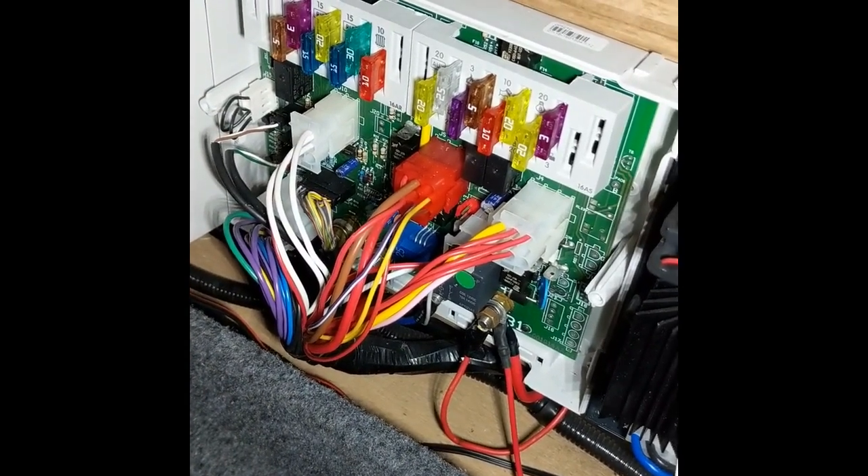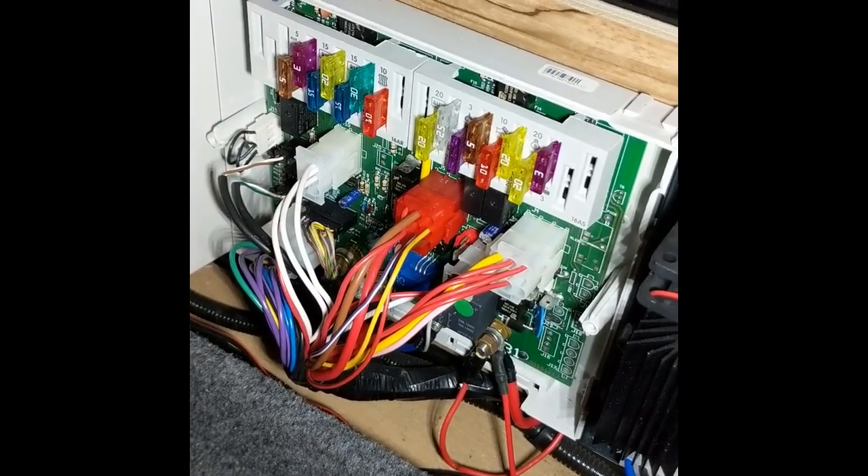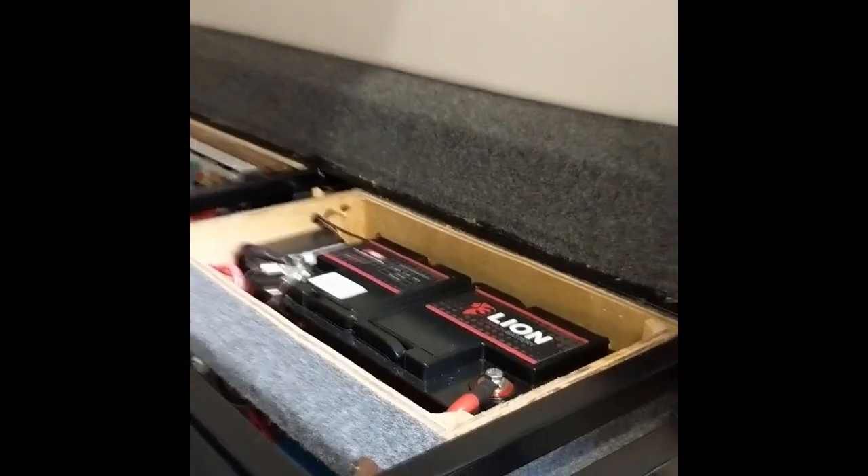The other thing is the relay is not a battery charger — it's just a switch. So it's not charging the battery in the way that a battery likes to be charged. That's why it's so important to actually install a lithium battery properly. And even a lead acid battery, if you want it to charge really well — as well as it would if it was connected to a mains charger — you would use a battery-to-battery charger.